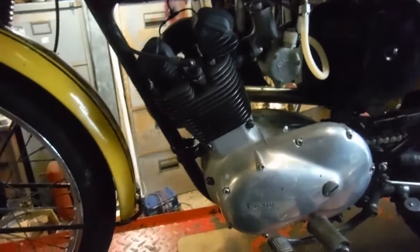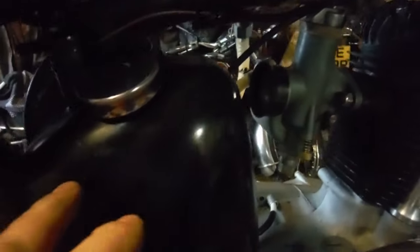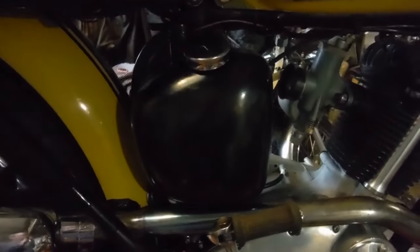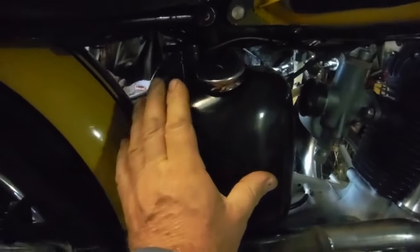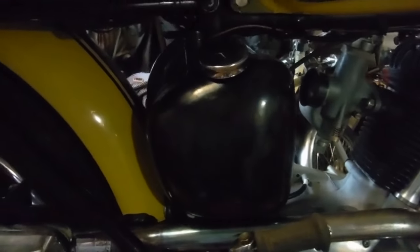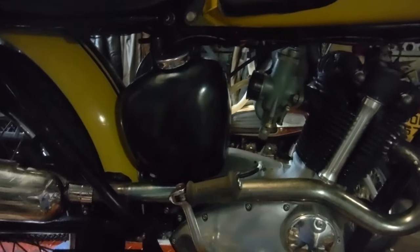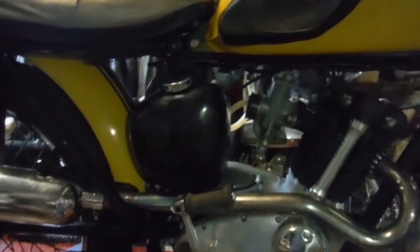I've already checked and there's absolutely no oil in the engine or the tank, but there was a little bit of swarf in the bottom of the tank so I cleaned that out. You nearly always get that — you really have to consider the oil tank as being part of the engine when you change the oil. Clean the oil tank out as well, or at least check it and make sure it is clean; that'll save tears, wear and tear, and sludge traps bunging up later on.